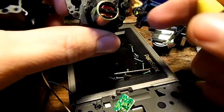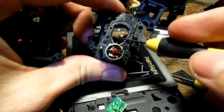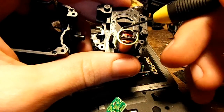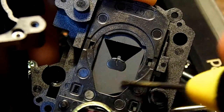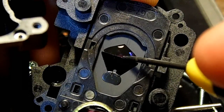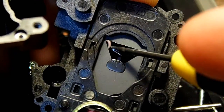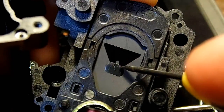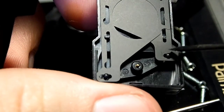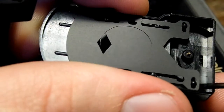There's the shutter - evidently that wasn't the motor for focus or anything, it was the motor for controlling the shutter. It's a double-shutter type thing: there's one shutter frame right here, then another shutter frame behind it. They're made so that one goes this way and the other goes that way - when you push it down they move away from each other. It looks like slightly transparent plastic material. There's also a little rocker arm down here that controls both motions at once.